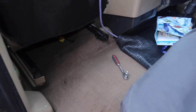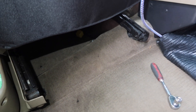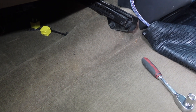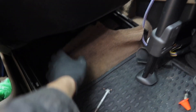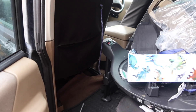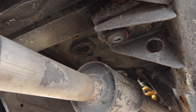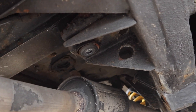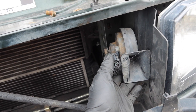The next top bolt for the body mount is under this carpet here. I'm just going to undo the seats — there's one bolt just in there and one bolt just down there, underneath this carpet. I did have to have an assistant just to get to this bolt here because it was just spinning. These ones under the back seat are actually captive, and these rear mounts I found to be captive as well, so all you've got to do is just wind them out — easy peasy.